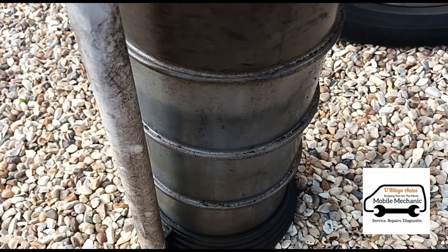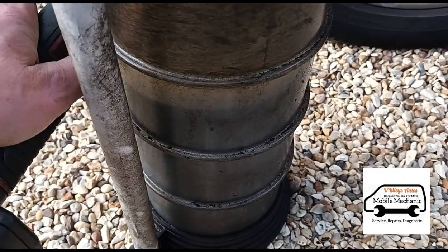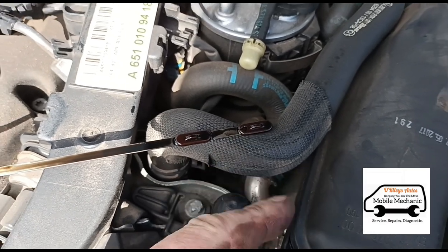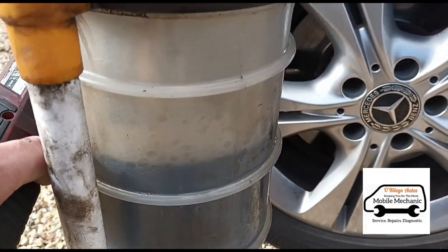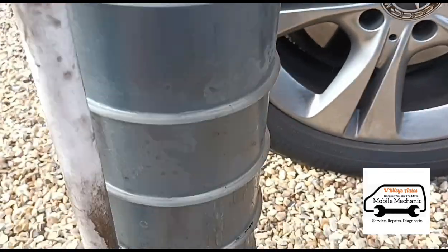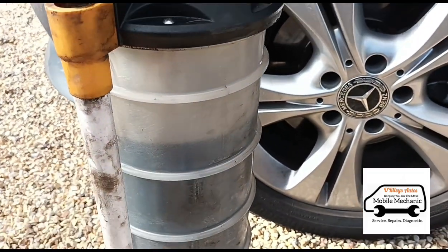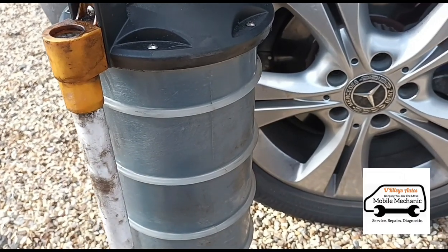You can see we've got about 2.5 litres in there so far. Hold the torch to it — on this particular car it should have about six litres, but when I tried the dipstick before it was on the minimum level, so we're going to have less than six litres come out. So far we've got about five and a half litres. This takes six — six will be here and 6.5 litres. Each one of these marks is a litre: one, two, three, four, five, six. Our extraction pump is actually full now — we've got 6.5 litres in there.